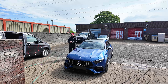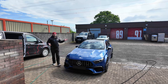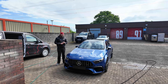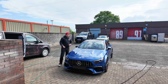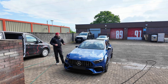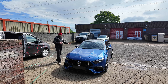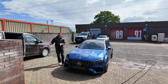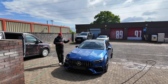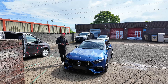So now we've got the A45S outside and it's ready to get deconed. This generally takes between an hour and a half to two hours depending on the size of the car. It consists of a pre-wash, we rinse that down, we then snow foam the car, go over all the sills, all the wee intricate areas with the detailing brush, rinse off the snow foam, we then foam it again with shampoo, and then give the car a wash over. It doesn't get a safe wash on this kind of package because it's getting a machine correction on it anyway, and there's nothing inflicted on the paintwork when it's washed that wouldn't be removed through the machine correction.